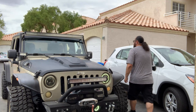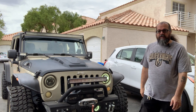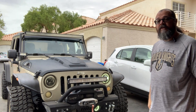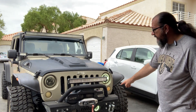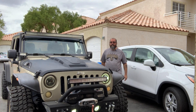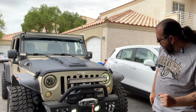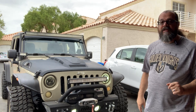Let's keep on taking a look here. With the headlights completely on, it's still a passenger side issue. The driver's side is completely lit — the halo is lit on both the headlight and the fog light, the headlight completely turned on. Now let's turn on the fog light to make sure that one still works as well. So now both fog lights are turned on, but the halos are not working on the passenger side, and of course the passenger headlight itself is not working.